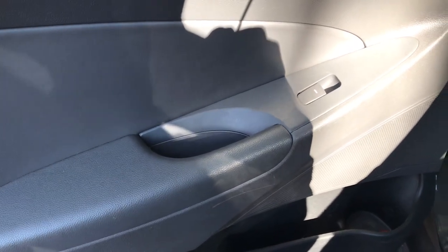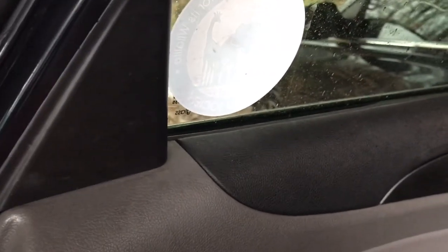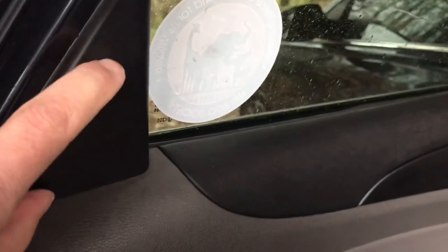That's why I'm doing this — we're going to see what's going on. After you've taken out all three screws — one at the handle, one at the little pull, and this one on the end — don't forget this little piece of trim because the door panel needs to come up, so you'll need to get this out of the way. This is a reenactment: to get this out, I just pop it out, kind of break it in there, and it falls out.